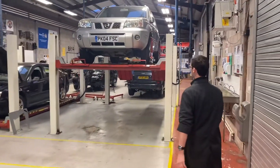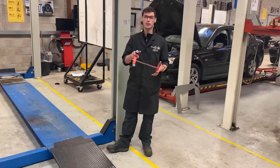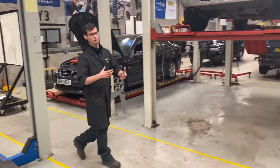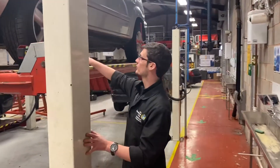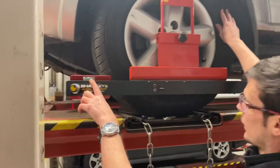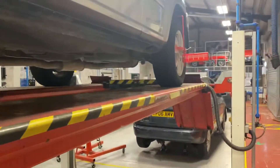The first thing you need to do is make sure that I have my steering wheel clamped before I set it up. I clamp the steering wheel in a straight-ahead position and make sure it can't move, because if it moves the steering will turn and I won't be able to track it correctly. Turning the gauges on — the gauges' three points of contact must be touching the wheel itself, not the tyre, and it must be level. It's on the steering plates as well, which means less contact, easier to turn, and that will help me track the vehicle.